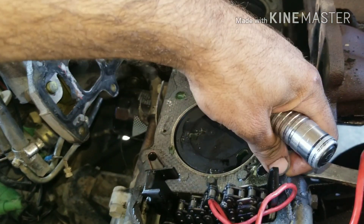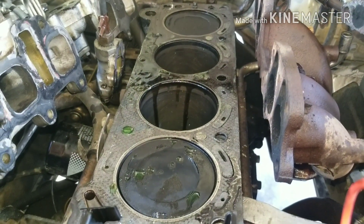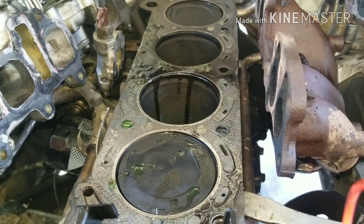Your next step is to take this old gasket off and start cleaning the surface. Use razor blades and Scotch-Brite to make it nice and shiny. Thanks for watching — I hope this helped you be your own mechanic and get this job done.